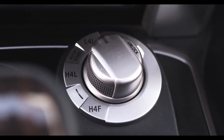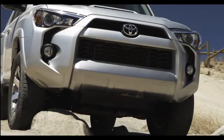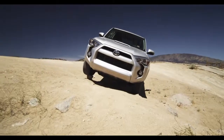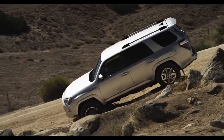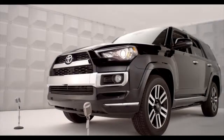L4L is the low-speed 4-Wheel Drive position. This is a low-range 4-Wheel Drive setting when maximum torque, power, and hardcore traction are needed — deep snow, sand, mud, crud, climbing or descending serious steep stuff, like pulling a boat trailer up a ramp.